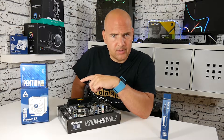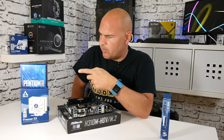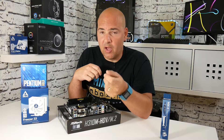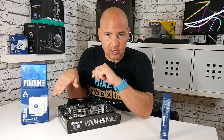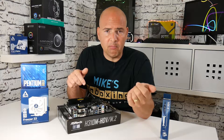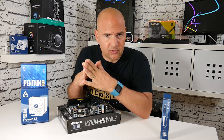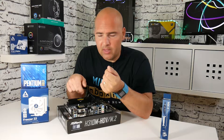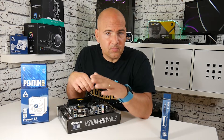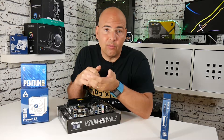You're probably wondering why we're installing a Freezer 33 onto a G5400 — that cooler is almost 20% or more of the purchase price of the actual processor. The reason is that the stock cooler that comes with these Intel chips is generally rated only a few watts above the actual thermal limit of the chip, so you're always running almost at full capacity of what it can cool. If you're using this in any form of entertainment system — media centre, movies, or gaming — you want to keep noise as little as possible. The Arctic Freezer 33 has technology so that if it gets below a certain temperature, around 40 degrees, the fan just won't spin — it will passively cool your processor, giving you a pretty much silent PC.